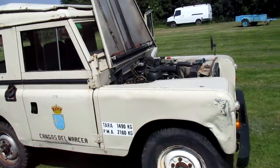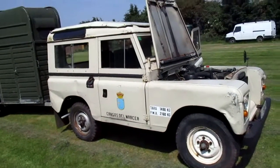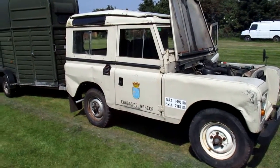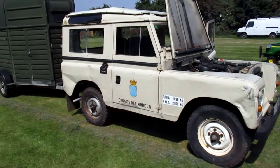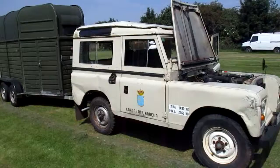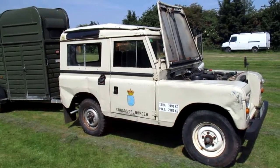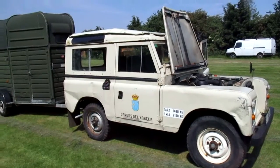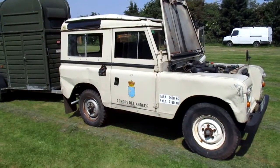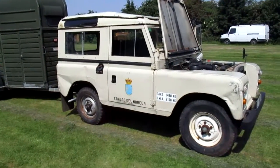A couple of things I noticed: there is an alternator belt needing changing, but it's just done 2,000 miles in three days — rightly so. Oils are fresh and clean — my friend Yago did them before the journey. Tyres are not matched: I've got Defender on the front and old Series 3 on the back. These don't suit alloy wheels but they do suit Wolf wheels or early Discovery steel wheels, which I always keep an abundance of. Chassis is perfect — there's nothing wrong with it whatsoever. This comes from Northern Spain where they don't have salt on the roads.